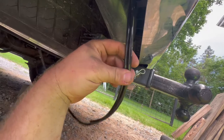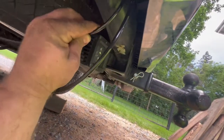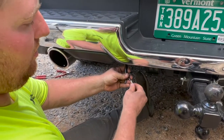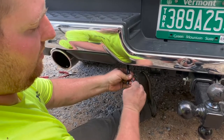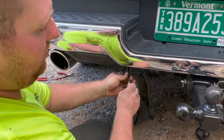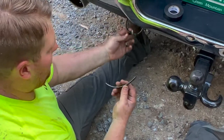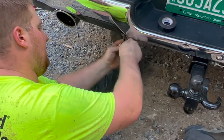We've got both hoses run from each side. We'll cut them and throw in the tee, then take a piece of the scrap tubing and run that to our single valve stem. Connect each end of the tee, making sure you get all those barbs nice into the hose. Then take your clamps and put them on the bottom of the tee.